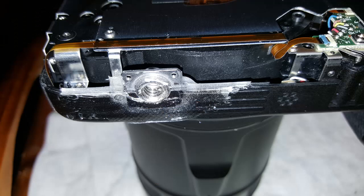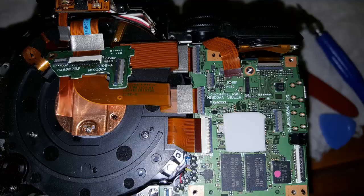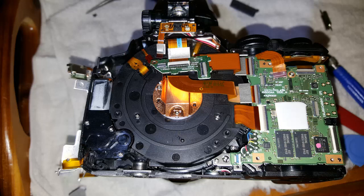If you want to do stuff with the CCD, now's a good time. You can pull out the three screws holding the CCD. I found that using a straw as a suck tube is a great way to pick up the IR filter if you want to pull that out. It's almost invisible so you've got to be careful not to lose it.